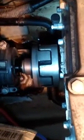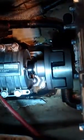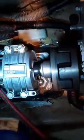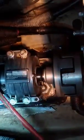All right, now you can see the spacing is a lot better. See that? You want to keep them apart a little bit, so that's good. I got my 4 bolts in there, Loctited, tighten my 2 clamps, and she should be good to go. Just going to clean all that debris out. Got to hook some of these clamps back up. Got to put the exhaust back in. Get the air box. Hook all that stuff back up. I mean, that stuff's easy. I'm not going to continue the video on that.